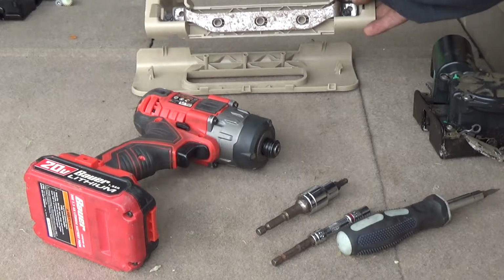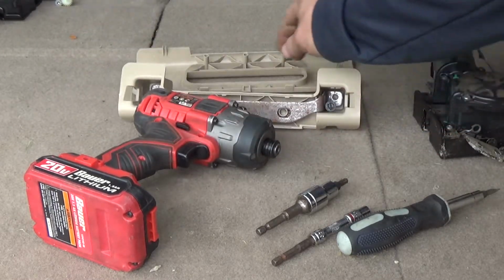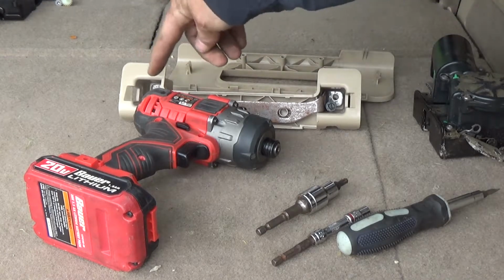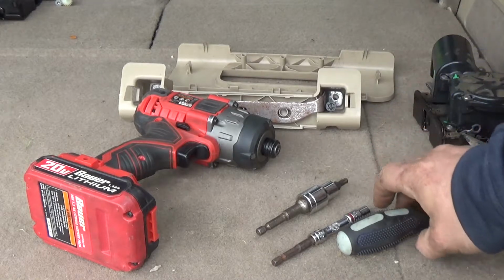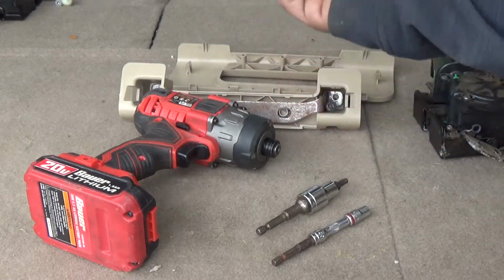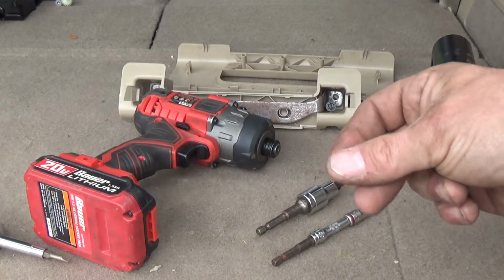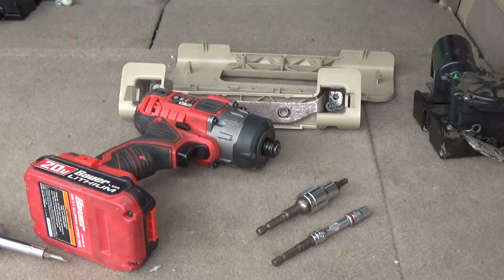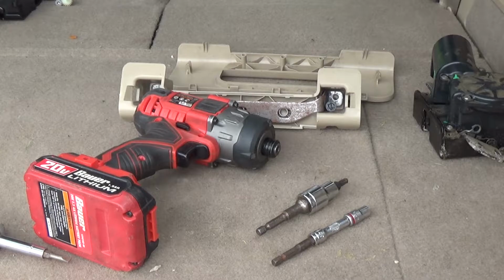To get the panel off the back door, you take this off, which consists of popping this cover off. You've got two 7mm screws, zip those out, and then you have where this is going to come in. You're going to have two little push rivets in the center, and then after that it's just a series of clips to pull the panel off. Now I've already done that on this one because I removed the old one.